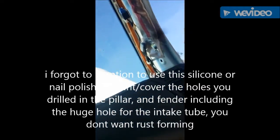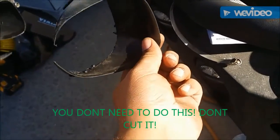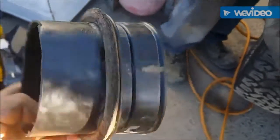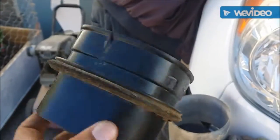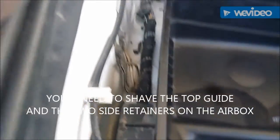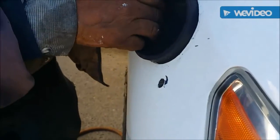The stock airbox had a little cone thing that was hanging out and making the turn very difficult for the adapter to fit. So I just chopped it off at where the tip of the cone starts — made it a straight cut and deburred it so it doesn't catch on anything. We then figured out why the adapter wasn't fitting: after shaving the cone off, we could remove the piece entirely. Looking at the bottom of the airbox, the adapter is going to slide right over it, but I have to shave down the pins so it creates a nice watertight seal. It only popped out about a quarter inch, so if it grabs an inch over on the airbox it should sit flush and we should be able to push the snorkel right on in.